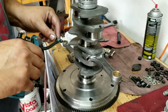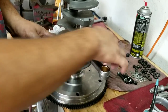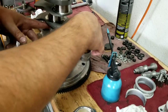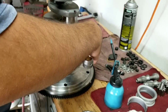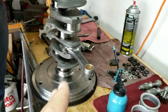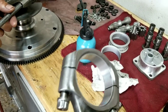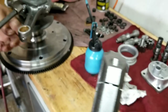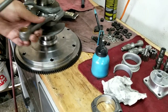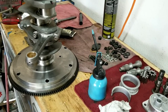We put them all together one at a time and carefully went through, tightening them up and making sure the bearings were seated where those little tangs are. The machine work was slightly off on some, so we adjusted by lightly sanding the bearing. Now that they're all tightened up, put all the rods back on — make sure the tangs are in the correct position, facing the camshaft side.